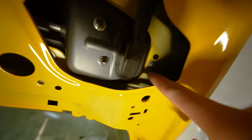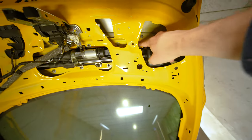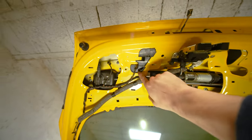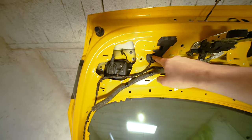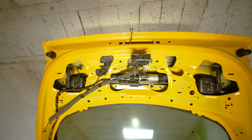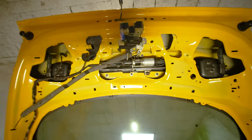You can see it has a yellow stud sticking through it. Going up and down: one, two, three, four, five, six, seven, eight, nine — the tenth is behind this plastic cover. That's why we need a screwdriver for that one. Then eleven, twelve, and thirteen — it goes in a zigzag pattern up and down most of the way. Once you count 13, if you have the right bolts it should be loose. The nuts have a really big flange and are really hard to miss.